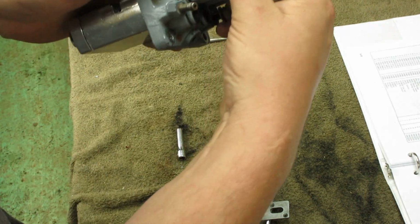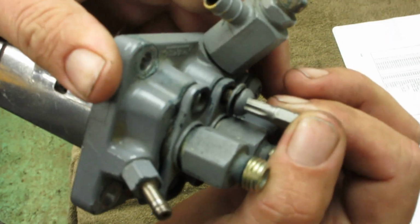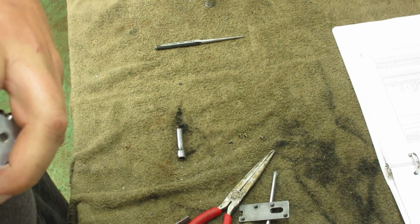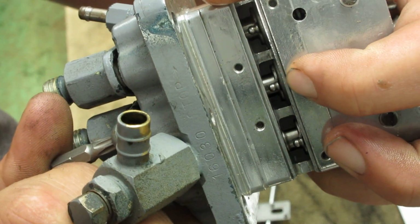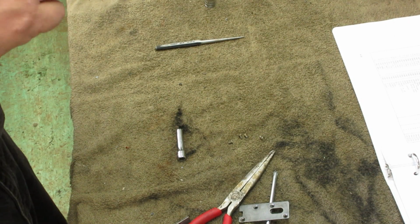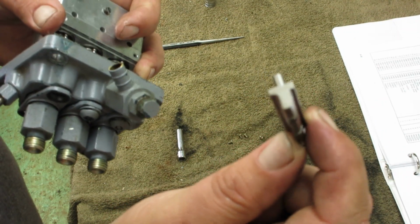All right, I figured out the issue. See how there's a gap? It's the spring tension pushing the thing out. And I don't know if you can see, see how it's bumped up right there because it pushes that little nub up. But this side I tightened down and it's down low. So it was forcing the rack in there at an angle, and that was binding.